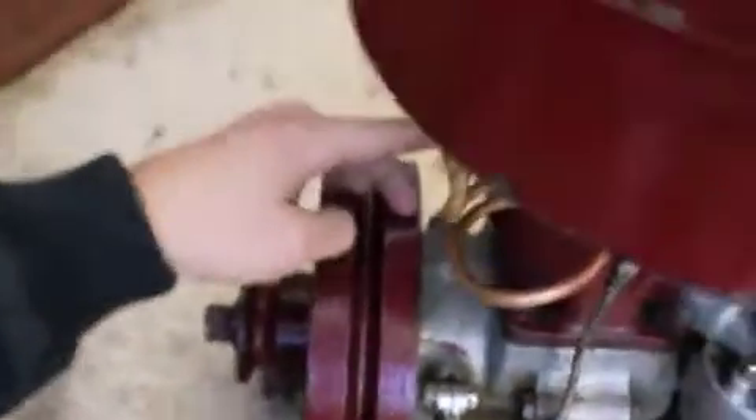Go around until I find TDC, which is there — you can just about see the piston inside there. You'll just feel it rocking. So I get the halfway out of that rock, pull the thing out. On this one I've already marked TDC on the flywheel and I line it up with the core plug, or whatever is easy to mark it up on.